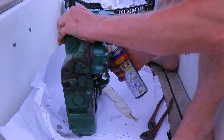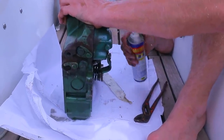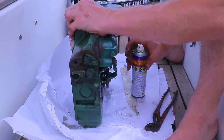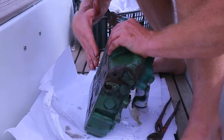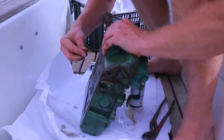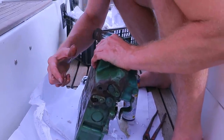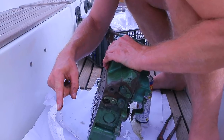I'm now going to give the injectors another clean out with some WD-40 to make sure there are no remnants of dirt in there. I'll also clean up the inlet and exhaust valves on both cylinders and clean the whole mating area where the gasket is going to sit. Afterwards I'll clean it with alcohol to make sure there's no residual oil or grease, because the new head gasket is installed dry - I'll do that on both this surface and the surface on the engine block.